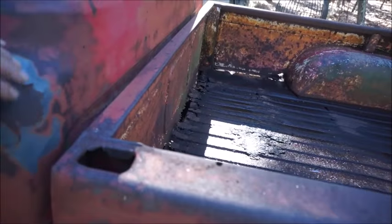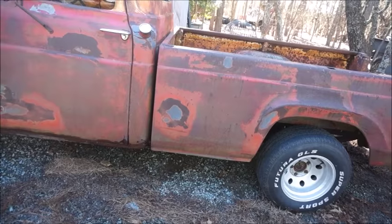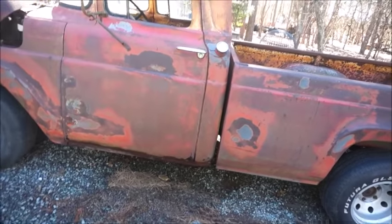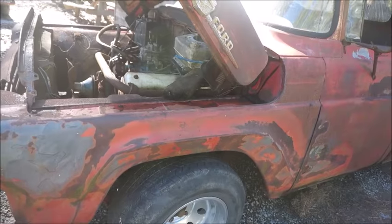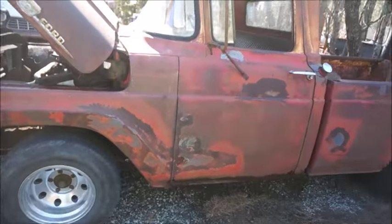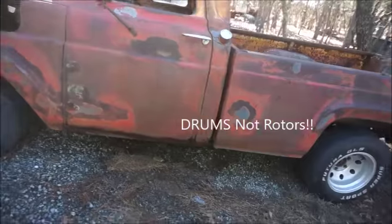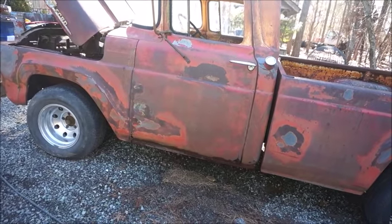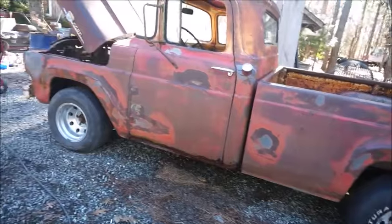I'm going to go ahead and order the brake stuff for this — new brake shoes front and rear, new wheel cylinders front and rear, new rubber lines: one rear rubber line, two front rubber lines. We'll make the brake lines and put a new master cylinder on it. Getting that stuff through Rock Auto is about the cheapest — probably right around $200, maybe a little less. We're going to replace the whole brake system, turn the rotors, repack the front wheel bearings, and make that all mechanically right. There's no reason to half-ass brakes. Try to get it running and driving, maybe streetable, and then we'll see if we can put it in somebody else's hands.